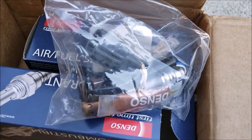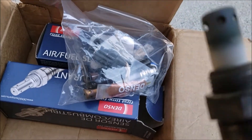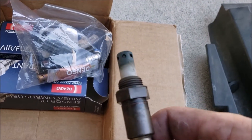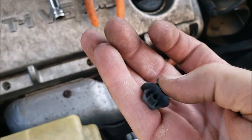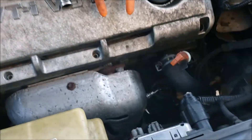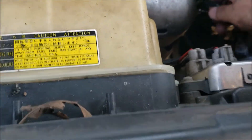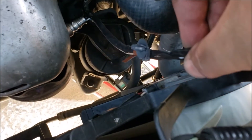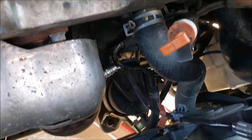There it is — that's your air fuel sensor on top, and we'll replace that with this brand new one. It's already got anti-seize on the threads, which you definitely want so that next time you try to pull one of these off, it actually comes off. The hardest part so far is getting this little dinky piece of plastic attached to the new one — I had to rip the old one off, but it's attached to the new one as well, so you really have to work at it.